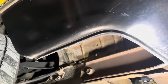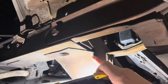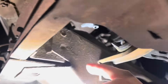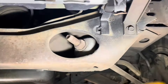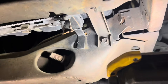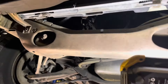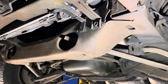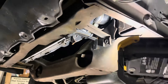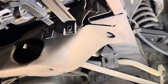Over here you can see where this steering crossmember has a little crack right here — there's a little crack right there. It's welded here and welded here to the body. But if we follow to the other side, it is completely torn from the body and separated. I know for a fact this thing has left the earth and impacted pretty good. That being torn away will offer overall steering instability because that's part of the steering geometry. So that has to be repaired — closed up properly, reattached, re-welded.